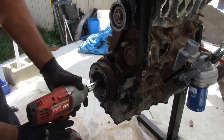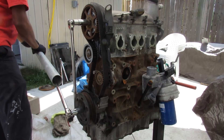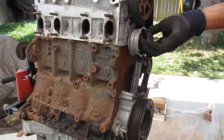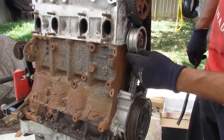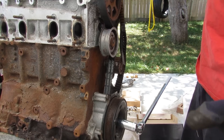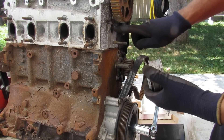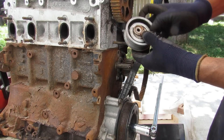Next I'm going to remove the crank bolt. I gave up on the crank bolt with the impact, so we're going to try that later. I'm just going to remove this timing belt tensioner here. This timing belt tensioner works kind of like an eccentric guide — the more you turn it, it actually tightens up on this belt. I'll just peel off this timing belt and remove this tensioner. It's a spring-loaded tensioner with tabs ingrained inside of the block that rotate like an eccentric shaft in order to tighten things up.